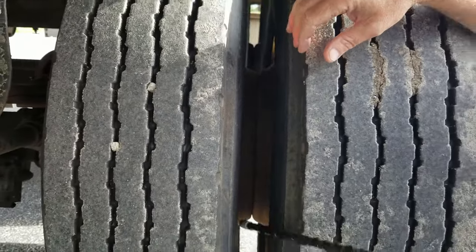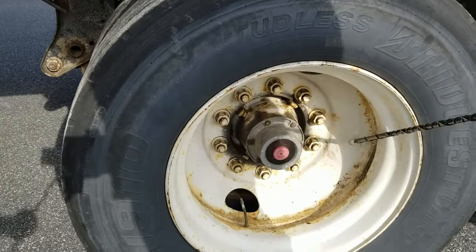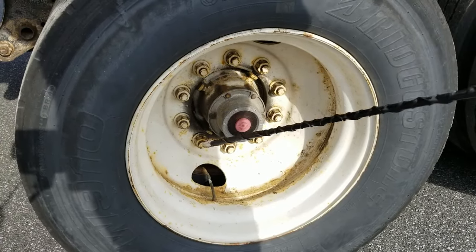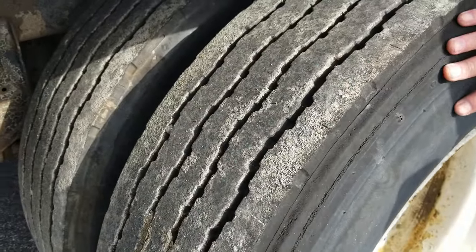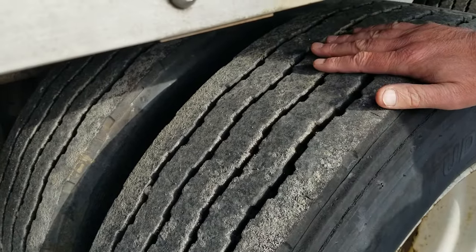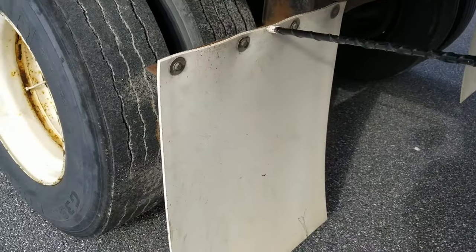Move to my wheel assembly. I want to check the spacing between the tires, make sure there's no obstructions and the tires aren't touching. I want to check my rims — these are bud rims — make sure there's no cracks, holes, illegal welds or damage. Check my lug nuts, make sure they're all there and tight, no rust trails or shiny threads that may indicate a loose nut. I want to check my hub seal to make sure there's no signs of leaks and it is between add and full. I want to check my tires — all four sidewalls — no cuts, rips or bulges, even wear, no mismatched tires, no tread separation, at least two thirty-seconds of tread. I'll check the air pressure with the air gauge; it should be 100 to 110. I want to check my mud flap, make sure it's securely mounted, no loose or missing bolts and no damage.